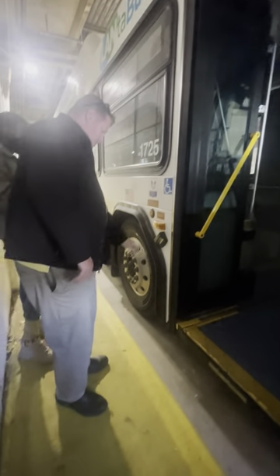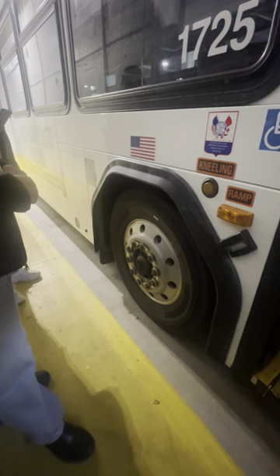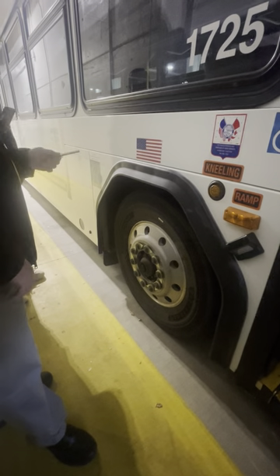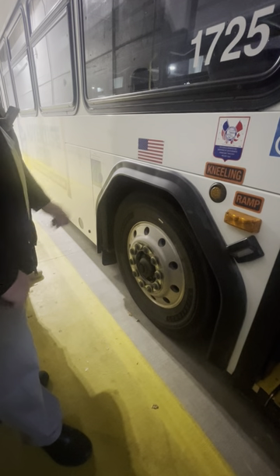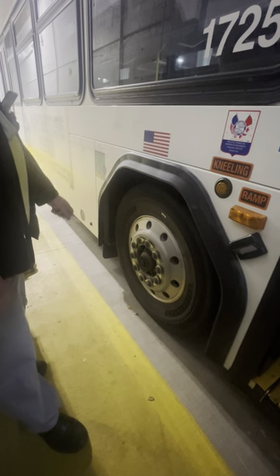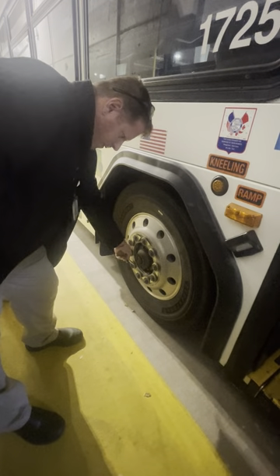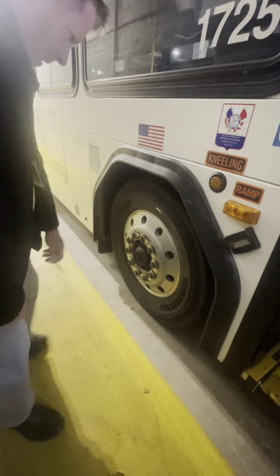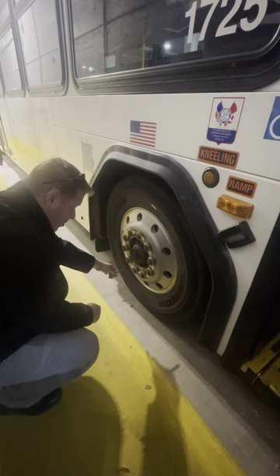Proceeding to the front wheel. Front wheel fender and mud flap — not cracked, not dry rotted. Front tire has at least four thirty-seconds of tread depth, no abrasions, bulges, or cuts — evenly worn. Rim is properly mounted and secure, no cracks, no dents, no illegal welds. All lug nuts are present with no shininess or rust indicating looseness. Hub oil seal is filled to the adequate level and not leaking. Valve stem is straight, has a cap, and is used to check air pressure.